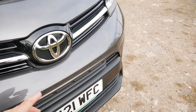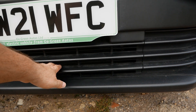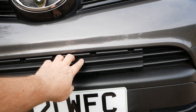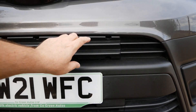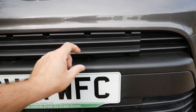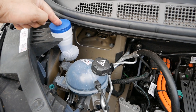Generally with electric vehicles you don't have much cooling because it's only cooling that motor, so generally you just have vents at the bottom going to that radiator. On this van the electric models even have a plastic cover which snaps in to block up the vents, because they're not required. If this was the diesel version, that bit of plastic wouldn't be there and there'd be additional vents behind there. Here's your windscreen washer bottle — that's probably the only reason why you would open up the bonnet on an EV.